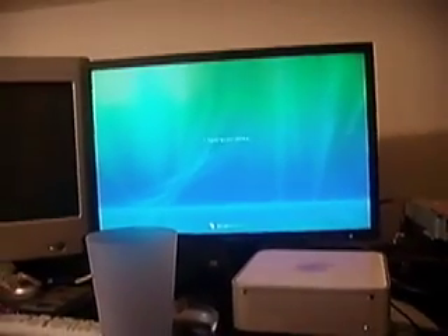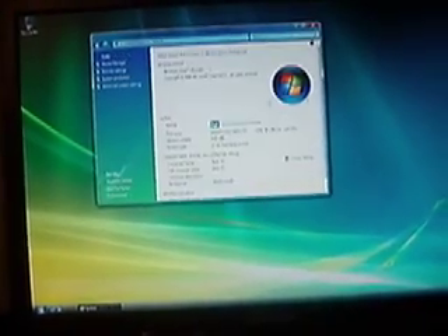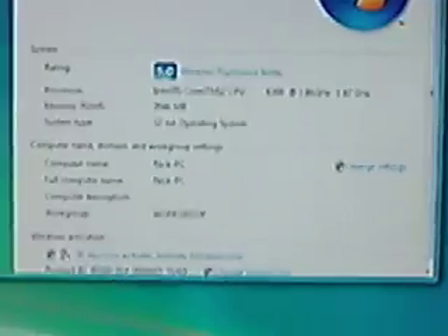Just put the side on your case, load up whatever operating system you're going to install, put it in the drive, boot up, and it should automatically boot to it. I'm installing Vista right now — Vista installs really quickly, about 15 minutes for the actual install process, and it came with pre-installed RAID drivers. There's also something really cool about the Cooler Master Stacker case: if you have a 10K Raptor X drive with the window on top, there's a dedicated spot to mount it — you take out the fan filter and put your drive right there. My Vista score right now is 5.0 with no overclocking at all. Once I overclock and get my 8800GTS, I should be up to around 5.7 to 5.9, which is the highest.